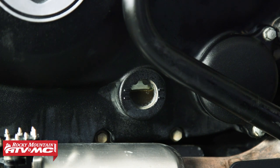We've let the bike sit and you can see our oil level is on that upper mark, so we know we're good. The oil doesn't look as clean as I'd like, but this engine leaves about a half a liter of oil in the bottom end, so it mixes in. If you're trying to get all of that out, you can lean the bike over a little more, but keep in mind you may need to add more oil.